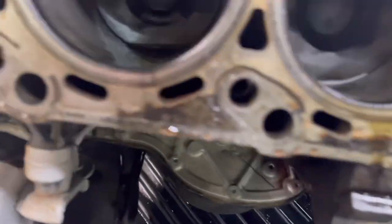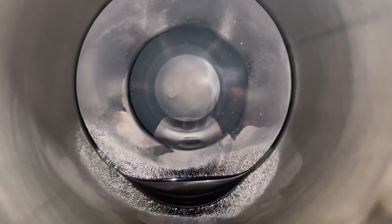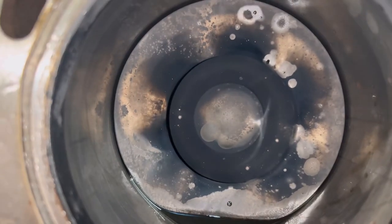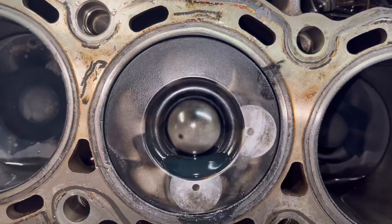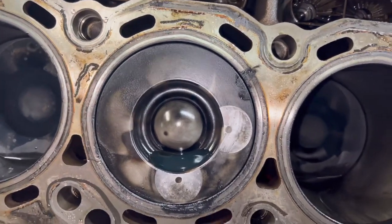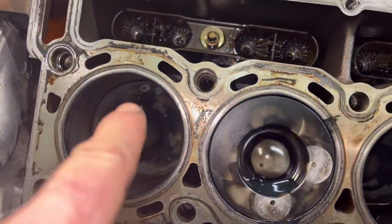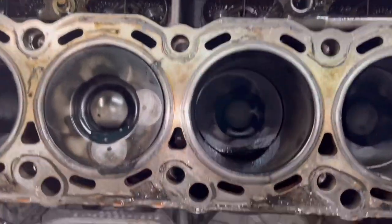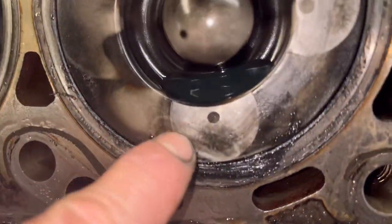Okay, let's look at the other witness marks. Look at all the other witness marks. By that I mean the lack thereof, which means chances are pretty good that the spring did it. If my numbers had been all wonky, you would expect a couple of kisses on some of the other ones, because all these numbers are pretty much uniform. And that really is not that bad.